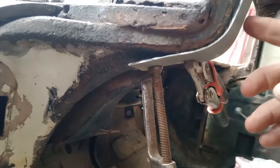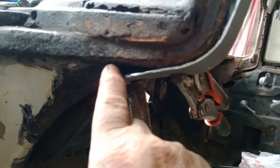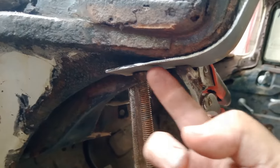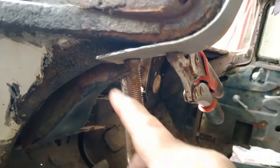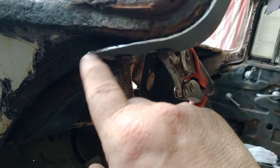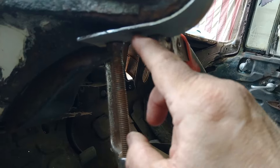I'm making this patch out of one long piece to patch the bottom of the A-pillar because she's got rust holes up in here. I've got her clamped in place and bent around, just cut the width. I'm just gonna take a ball peen and gently tap this so I get the radius that I need in there.